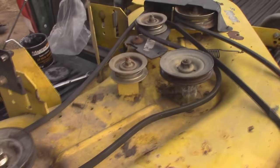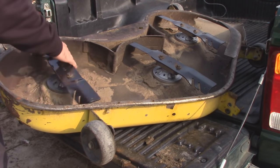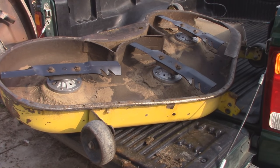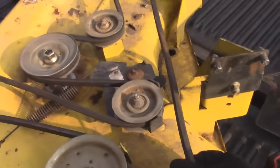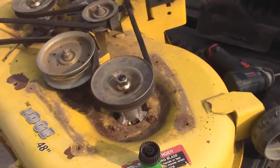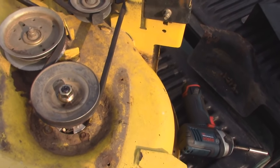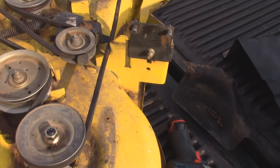So now just to get on with the rest of this, and I'll meet you guys back with the next step. All the blades are in now, everything's tightened down. These are a little bit wider than the old ones but they seem to be okay. That sound you're hearing is the belt brushing up against the pulley. I'm going to flip it back over, throw the belt guards back on, make sure the belt is wrapped. I am going to hold off on changing the belt out, mainly because this one's actually still good — there's really nothing wrong with it, just a couple nick marks, but that's normal usage on a belt that's about a year old. So I'm just going to keep this one on, and when it breaks I've got another one on hand.